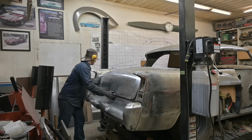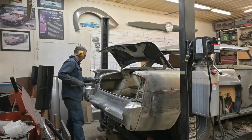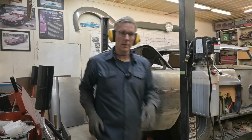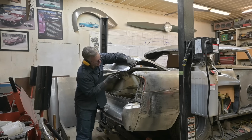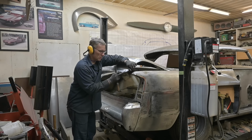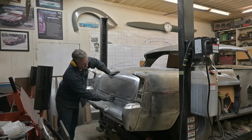Yeah. Well, this improved this side immensely. I can just move this over that way. I think we're going to have it. Okay, this is factory. I'm trying to distort the lead that's in here. See, I haven't taken that lead out. That's original. And by me hitting it in there, that lead's starting to crack, so I'll have to melt that out. Not filing through the hem, just adjusting my weld there. That's where that joint is. It's good. Me likey.